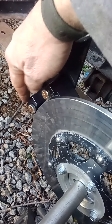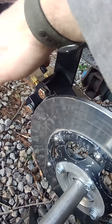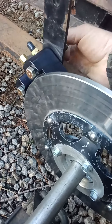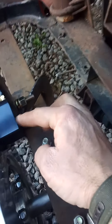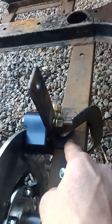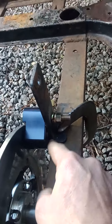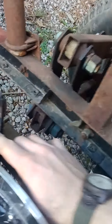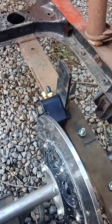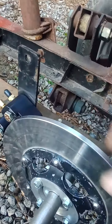I've drilled the frame here. I'm gonna run a long bolt through with the other caliper half out into the frame. I've got it butted up so it almost captures the nut a little bit. I've used this heavy-duty bend I got off a mower — it was a preformed bend — and I'm gonna use that as basically a caliper bracket, weld that to the frame. It bolts over here to this half, keeps it from moving, and then I'll cut and grind that off. That way we'll have hydraulic brakes — that's a 10-inch rotor, quarter-inch thick.